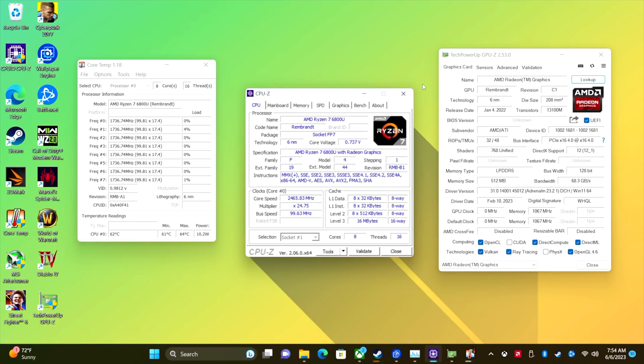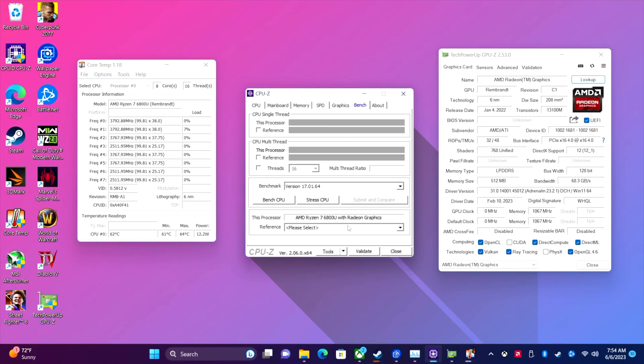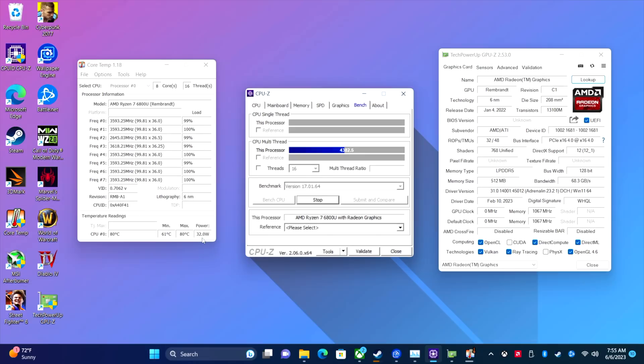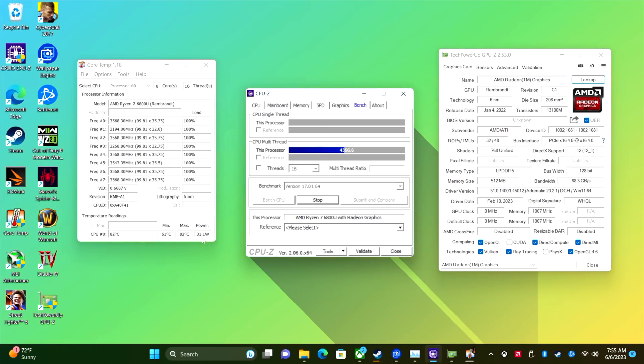Going into the BIOS, we can adjust the SMU options to tune the TDP. At stock configuration it boosts up to around 38 watts. Running a CPU-Z stress test, you can see it sitting around 33–35 watts, occasionally boosting to 38. This thing also stays pretty cool and it's not that loud — the fan is very manageable, not whining at all. Running the 6800U at higher wattages would help performance, but we're limited by the size. At 35 watts, I think it's perfect for this mini PC.